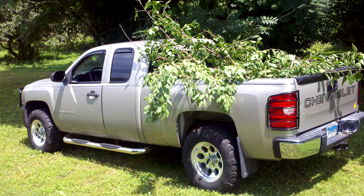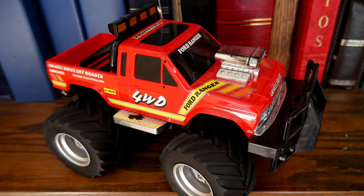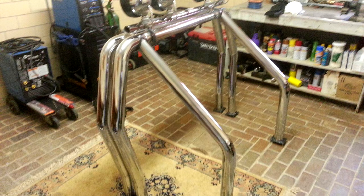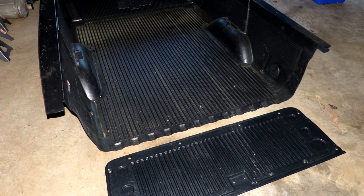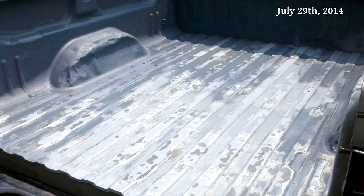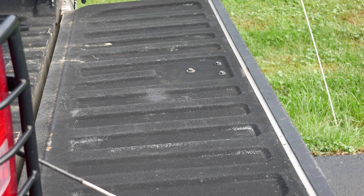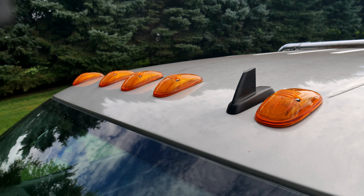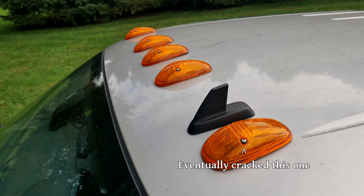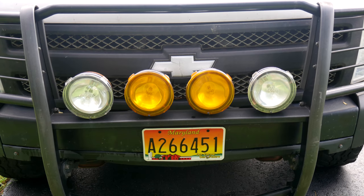At this point I had owned the truck for around six months and it had served me very well, but I still wanted to modify it more. Since I was little I had always loved light bars and roll bars on pickup trucks, so when these came up for sale on Craigslist fairly nearby with lights for a decent price, I ended up going for it. Before installing those I removed the plastic bed liner the dealer had installed and found out exactly how bad a shape the bed was in. After two days of sanding, hammering, and grinding everything as flat as possible, I filled some of the dents with fiberglass body filler, primed the entire bed, and applied some roll-on bed liner. Then I drilled holes, ran wires, and installed the light bar. At around the same time I also installed aftermarket cab lights designed to look like the markers on Dodge trucks — I wanted them simply because I liked the way they looked. At the same time I wired for additional lights to attach to the brush guard on the front of the truck.